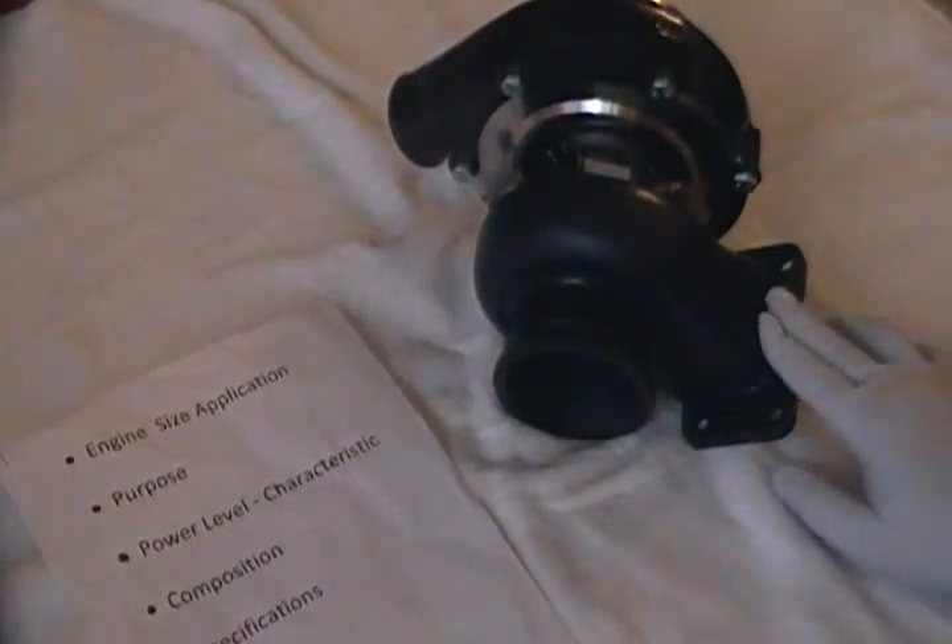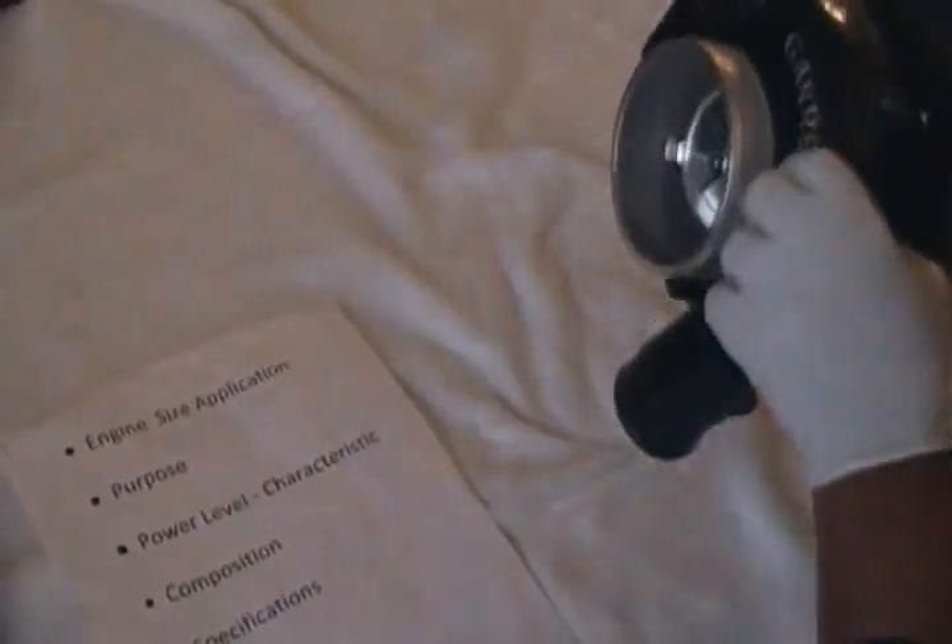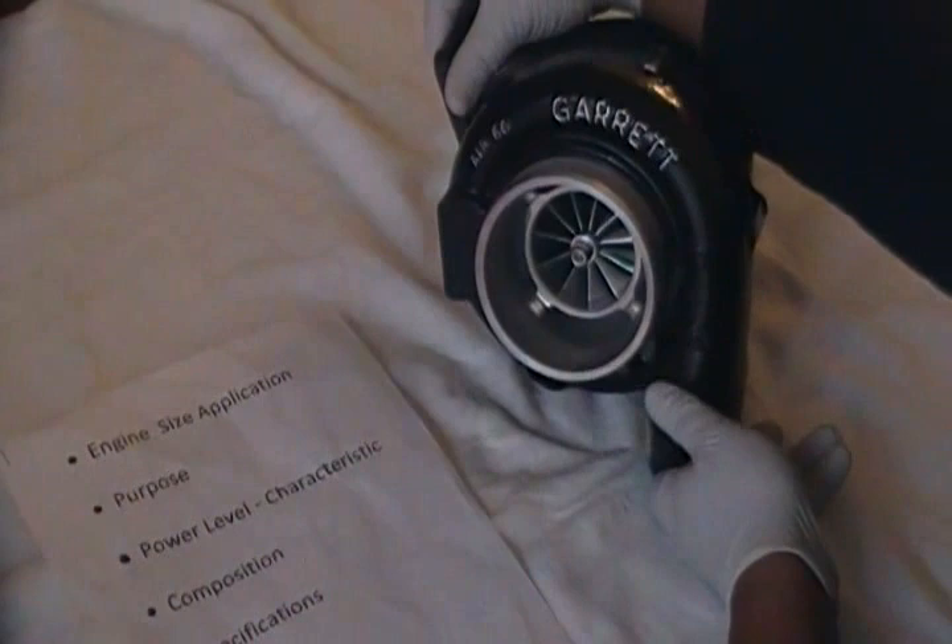You also have the option of a T3 1/2 2.5-inch 4-bolt. For those that had a T3-T04E in the standard 4-bolt configuration, you can now pick up this turbocharger and still get it in a 4-bolt configuration that will bolt up to your existing downpipe. You don't have to necessarily change this out, though many people tend to do so because it's better looking and easier to assemble and disassemble.